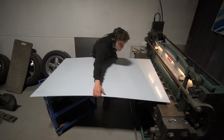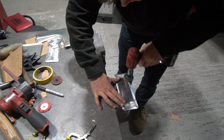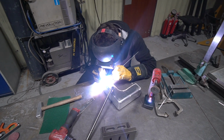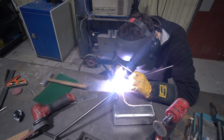Probably going to be teaching people to suck eggs here, and I may have said about it on a previous episode, can't remember now. But you have to remember, water has a coefficient of expansion. The reason cars have a header tank or an expansion tank on top of the radiator is because water expands when it gets hot. No surprises there.